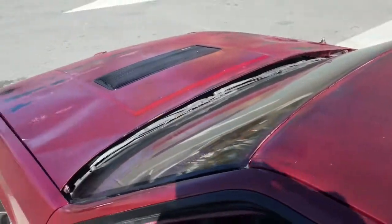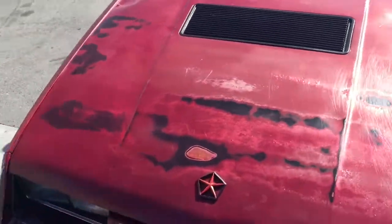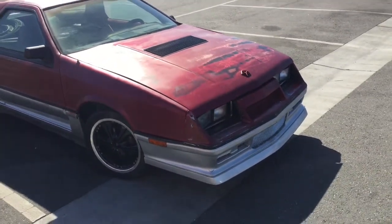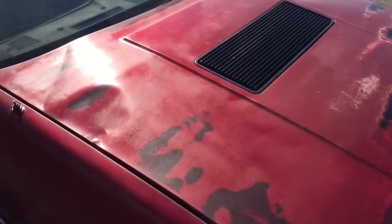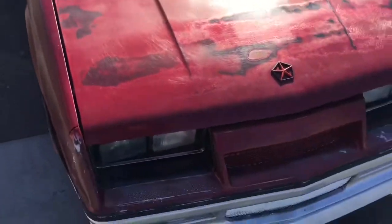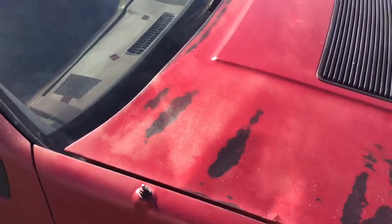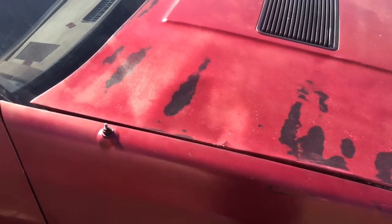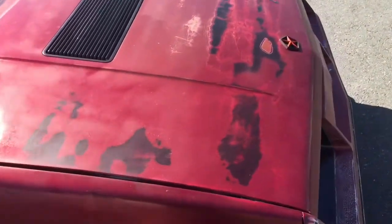Obviously the paint. This hood, when I got it, was really nice. But either it had a manufactured defect where it would pop open randomly, or we forgot to shut it before taking off. The hood popped open and almost snapped off on the freeway. You can see those dents — it was able to get back into place, but the coils on the inside had kicked forward. I had to remove them, push the hinges back, drop the hood and lock it. The bodywork repair will have to come later.